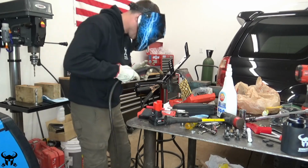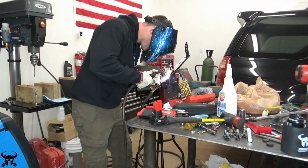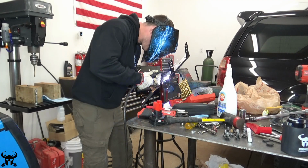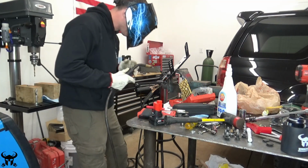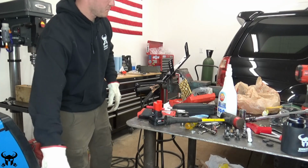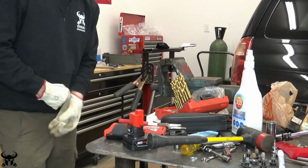These Nagisa seat rails were really poor from the factory. What happened is they transposed two of the tops of the rails, and I ended up having to basically grind off a bunch of tack welds and disassemble the seat rails and then flip everything around and then re-weld the tack welds after I got that done. It was a lot of work.